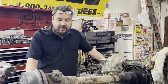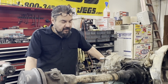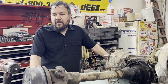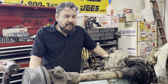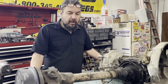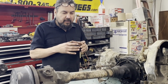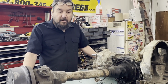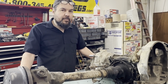So yesterday we had ourselves a setback. Christine was draining the oil on the transmission and found the pieces. It appears to me to be a spring to hold those little shoes in the synchronizer assembly. So we decided we better take it apart. We're going all the way to the coast with it, and I don't want to take it apart.